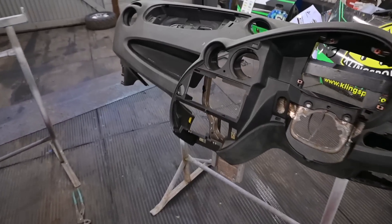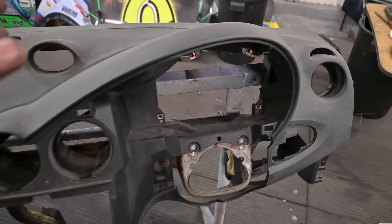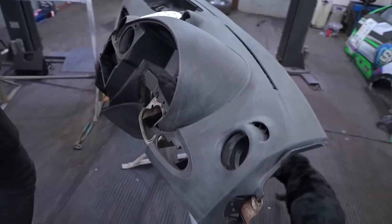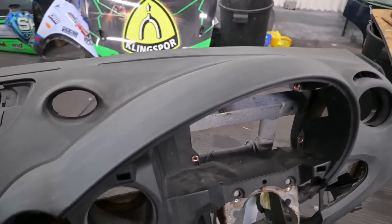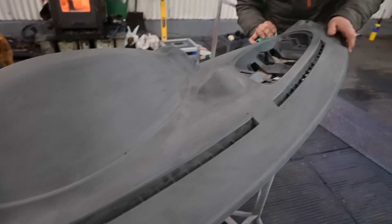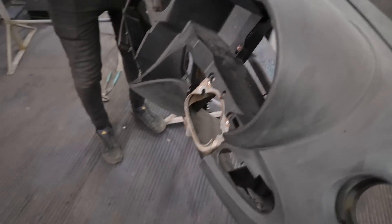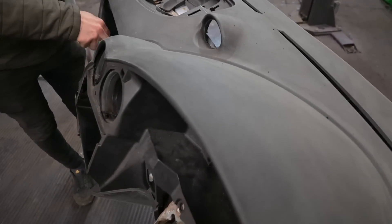I'm getting nervous. Right, so we've been watching a load of videos and we're just going to rough the dashboard up a bit more, maybe with some 180 grit — just a little bit more. Then we're going to use some degreaser and get it cleaned down with some acetone. We're going to put off the 3D printing thing for tonight and jump back on with that tomorrow. I just want to get this on so it's curing and I don't want to stress myself out too much. From when it's knocked back and we've mixed the stuff and applied it, we've got 15 minutes to get the flock on. We're going to take the dogs out of the room and put a car automotive spray sheet down on the floor so the fibres go on there. If this works out really well, I might put a little booth up in the corner or get a little shed just outside that we can apply this in.